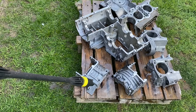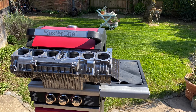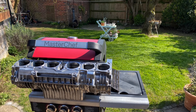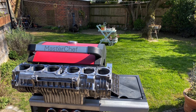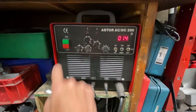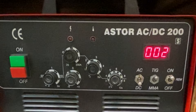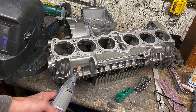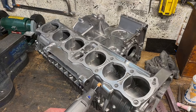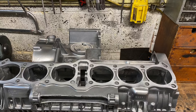I assembled the crankcases and put them in my barbecue and gave them a good heating up ready for welding. I tried to get them to at least 150 degrees — this can be difficult when they're so large but I give it a go. This is my 200 amp AC/DC TIG welder; it runs on single phase electricity and I bought it about 10 years ago. With the welding complete I used my Dremel to clean up all the welds to make them smooth and make the engine blend together as one.